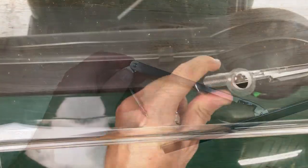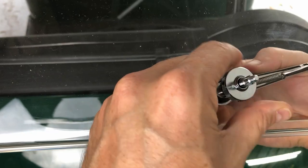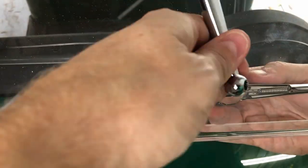Now we'll mount the wiper to the windshield by pushing the shaft through the half inch windshield wiper hole, then reassembling the washer, collar, and handle in the order they were removed. Make sure the rubber washers are both making contact with the windshield.